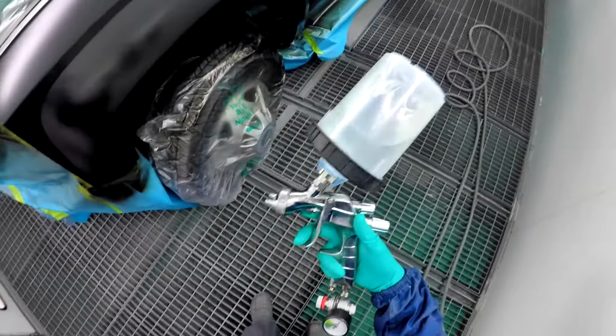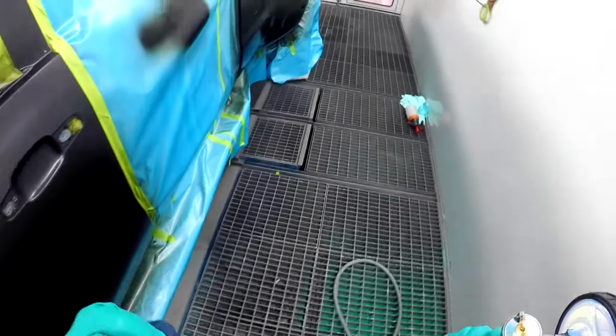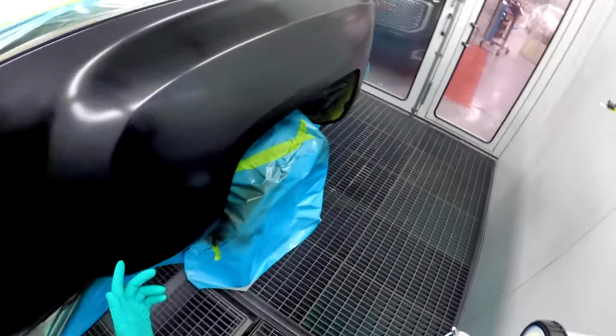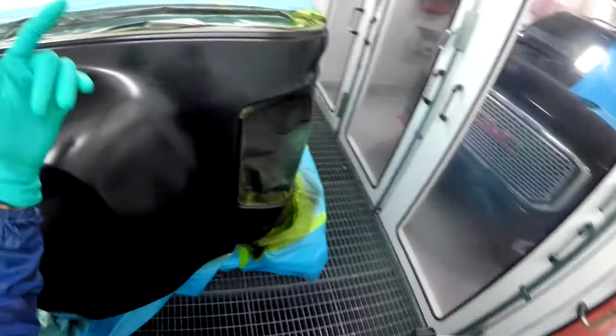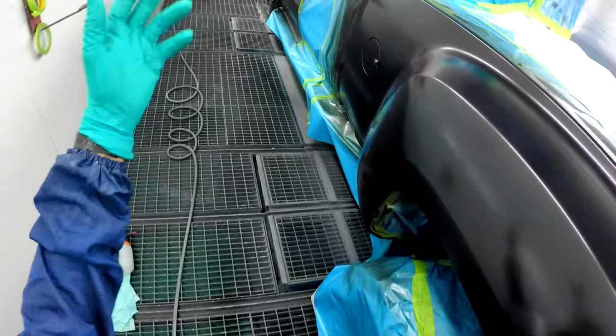35 PSI is what I like to spray at. And one of my subscribers commented to start at the bottom on the first coat and then start at the top on the second coat. So we'll try it out and see what I think of this one.